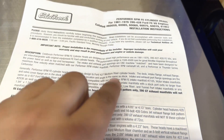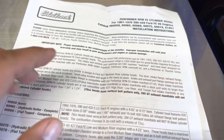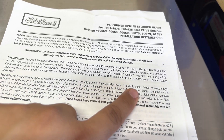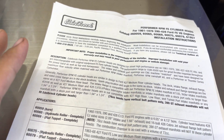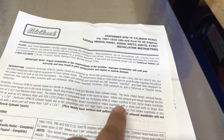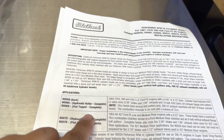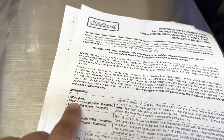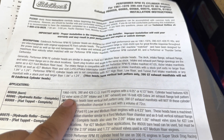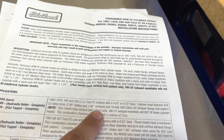So here are some specs. The performance range for these heads is 1500 to 6500 RPMs. These are actually modeled after the 427 medium riser heads — the deck, the intake flange and all that is in the stock location. The only thing to worry about is these heads are not compatible with the high riser, low riser, and tunnel port intakes, so be mindful of that when choosing an intake. The model number I have is the 665, which is set up for a hydraulic roller camshaft. A very good feature is that it has the large 428 Cobra Jet valves — 2.09 on the intake and 1.66 on the exhaust.